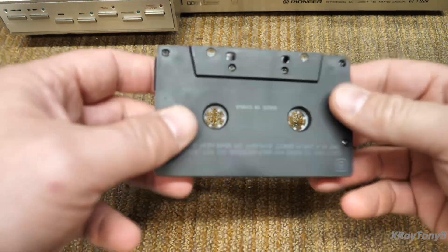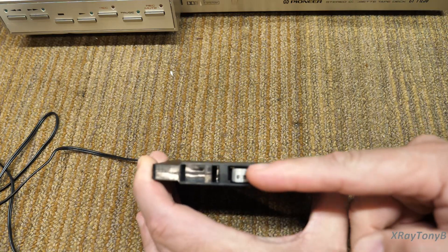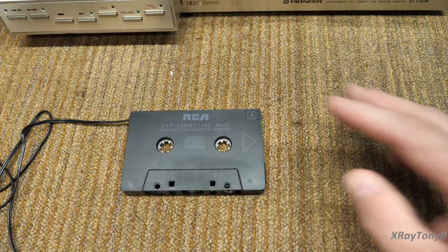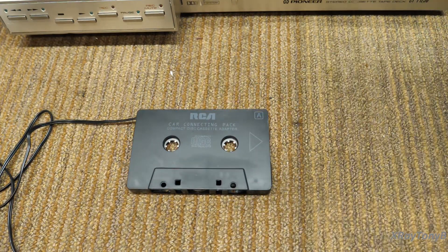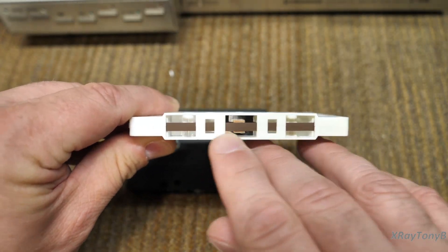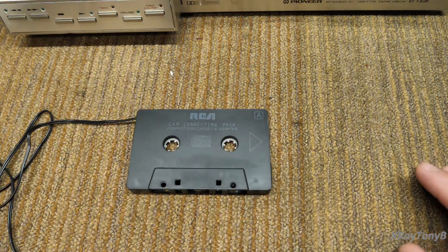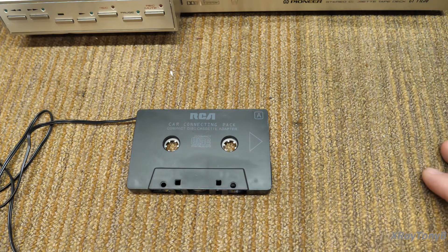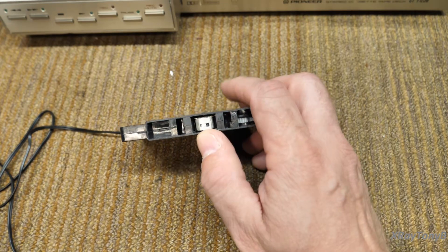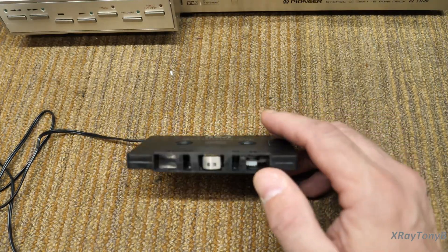Number two: this is a cheap plastic cassette, so we don't know how properly aligned this head is. It would have to be exactly precision-aligned so that when you adjust the azimuth and so forth, it would be tracking at the proper dimensions. Whenever they record these test tapes, the head placement with respect to the tape is set to a standard — that azimuth is very critically aligned on the recording device used to make those test tapes, and every adjustment you do is based on that. Without knowing how precision-aligned this adapter is, you may set the azimuth to it and it'll be non-standard, and all your alignments are going to be off. It won't work.